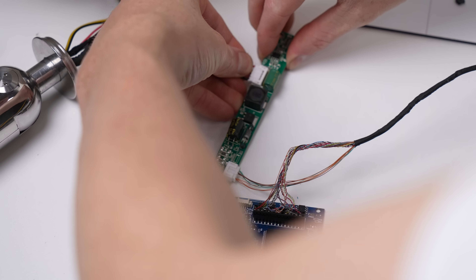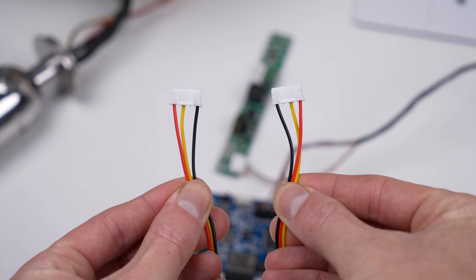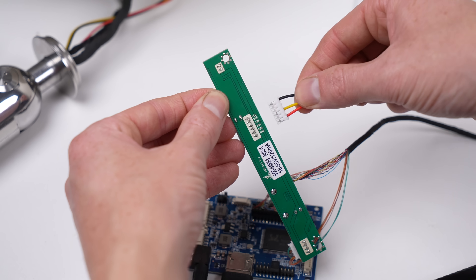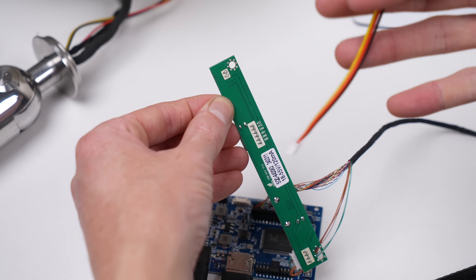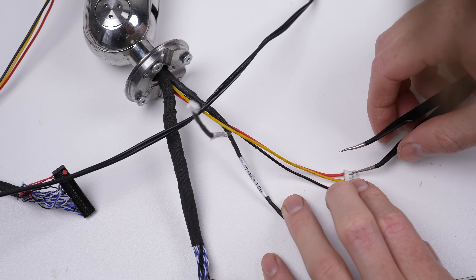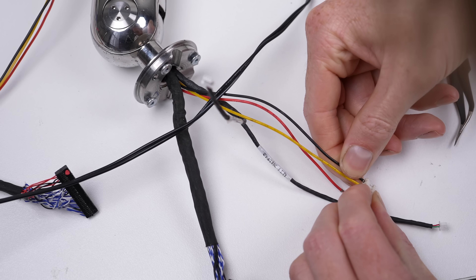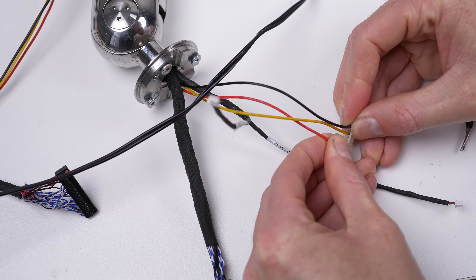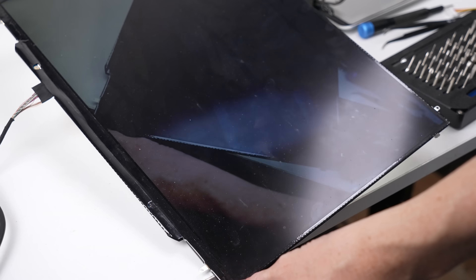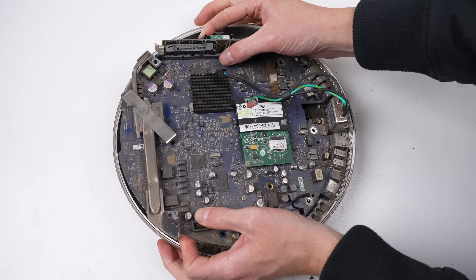But even with the original backlight cable I was still not getting any backlight. At a closer inspection I noticed the pinout was different at each end - a wonderful bit of electrical engineering. Turning the cable around swaps the positive and negative, so I just needed to swap the wires around for the backlight cable and retest. Thankfully nothing was damaged as a result of the reverse polarity and the display now works.